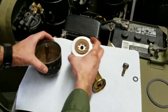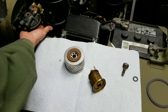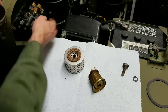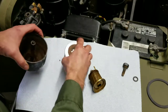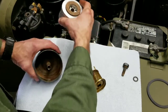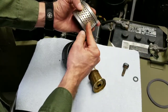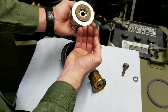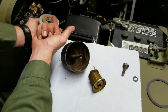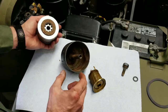When you put the new fuel filter in it has to go on a certain way. Think about it as: fuel is pumped in from the inline — the inline goes to the outside of the filter, that's where fuel enters the canister. It filters through the perforated holes on the outside into the inside, and then back out through a separate hole in the cover of the fuel filter.